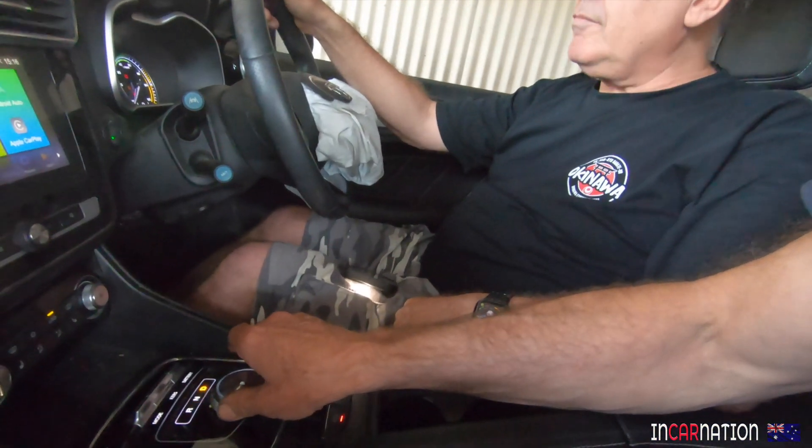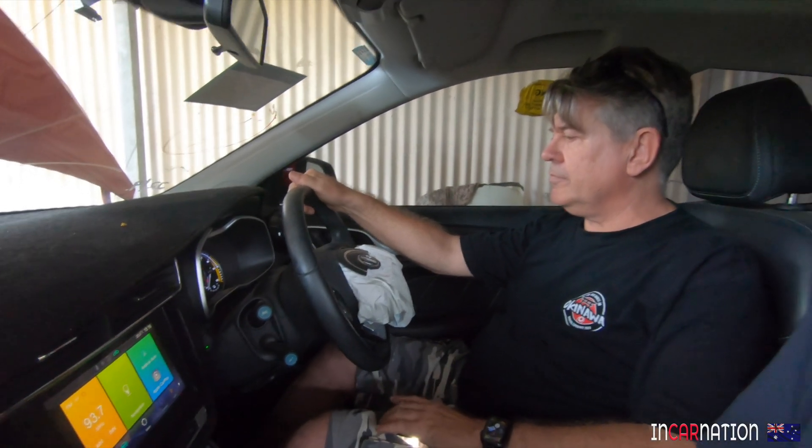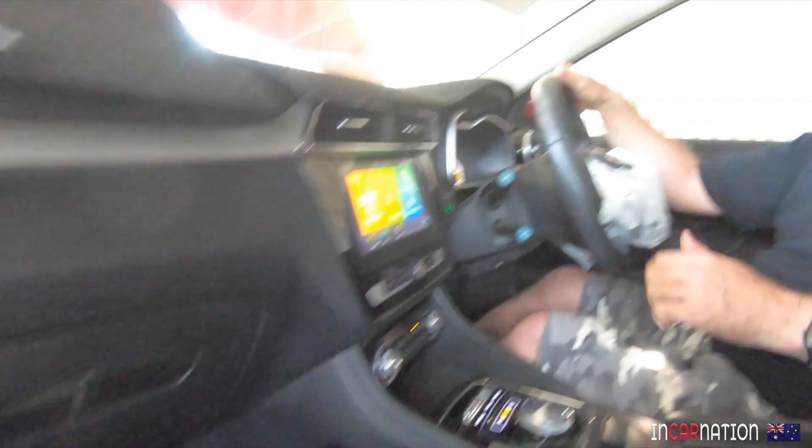This is Wayne - he's part of the video because he's had three MG ZS EVs and he understands how they work. If we put it in drive right now - foot on the brake - nothing's happening. Because it's disconnected the contactors to the high voltage battery. The SRS unit remembers it forever, it's not resettable - they're a disposable item. You've got to buy a new one. If we unplug the SRS unit, she'll drive. You'd think it would work the other way - if the SRS unit's faulty or missing, nothing's happening - but not the way it works.